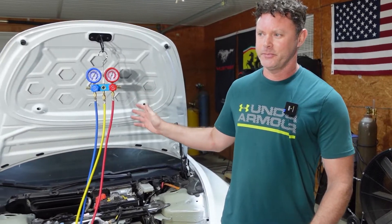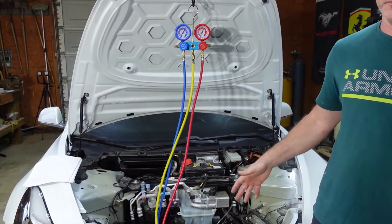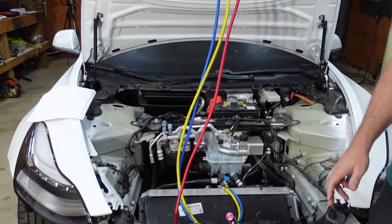I know this job looks very overwhelming but it's actually pretty simple. I'm going to teach my 14-year-old son how to do it and he's going to do everything, so maybe after you watch this you'll be fairly confident you can do it yourself. If you did this at a shop it would be over $300 to pull a vacuum and recharge it — and they're only going to pull a vacuum for five to ten minutes. You really have to pull a vacuum for 45 minutes to get all the air and moisture out of the lines, which is the most detrimental thing to this process. Take your time, make sure you don't have leaks, and get all the air and moisture out.